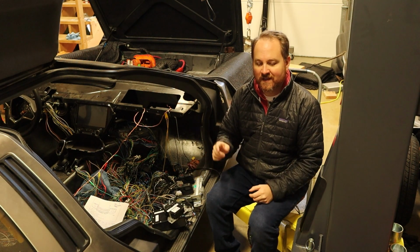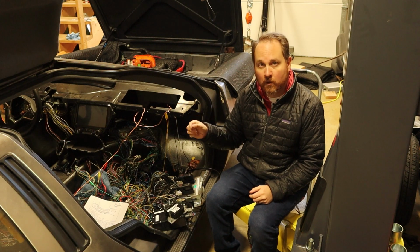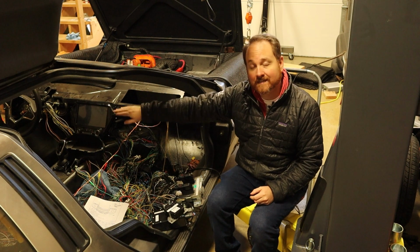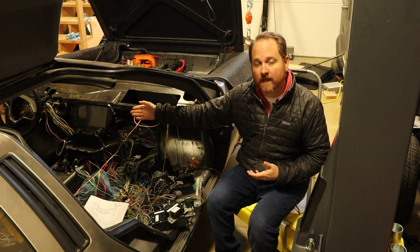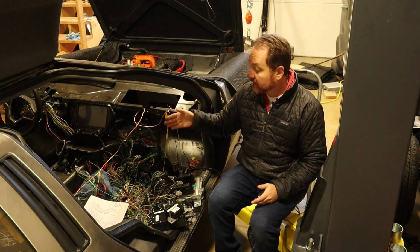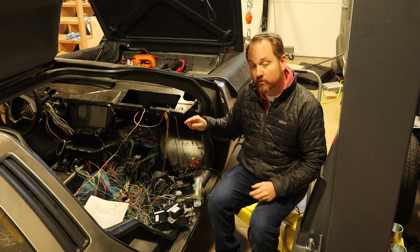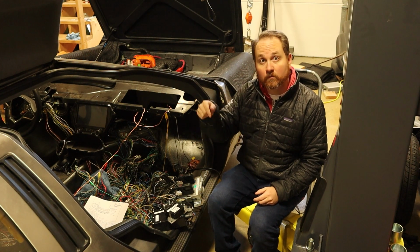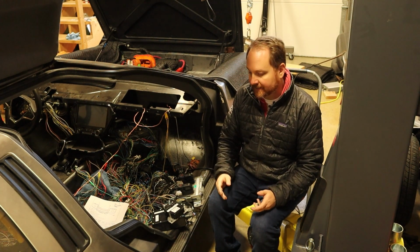But that's not all. I also found that I have other devices that are not plugged in. So my power steering motor, the cable is over here in this mess of wires, and it's just not long enough to connect over to the power steering motor yet. At some point, I will get around to extending that line and plugging it in, but for now, it's disconnected. Well, the CAN bus goes through that too. So what I've had to do is bridge those connectors to basically add a little jumper wire so that the CAN bus is not broken.